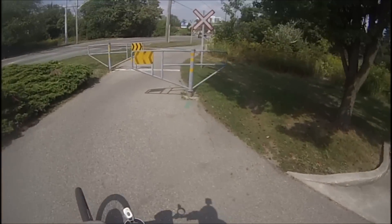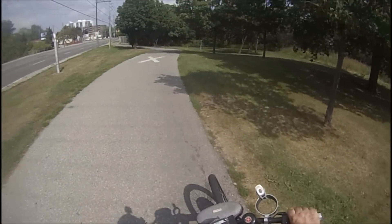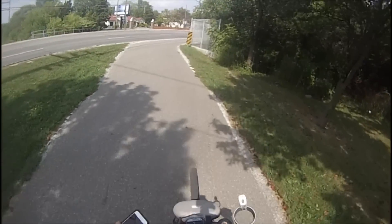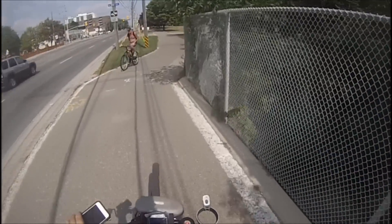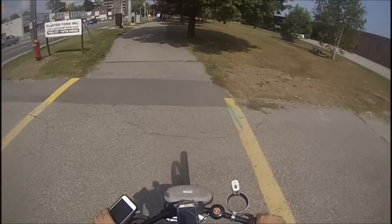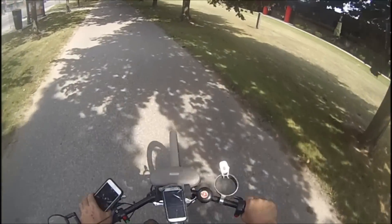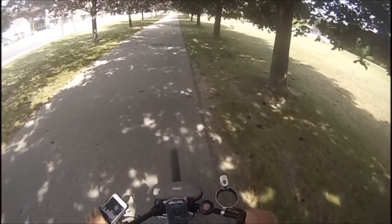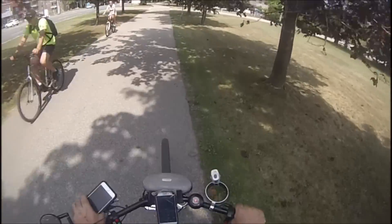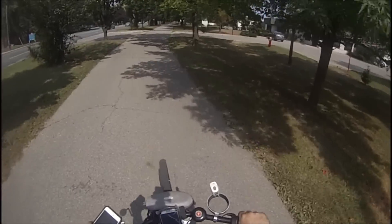We're at 20 kilometers an hour now. This could be different for every bike and every rider — experiment yourself. I seem to be getting 20 kilometers an hour when I have it set at 140, which would be perfect for cycle paths. At this setting of 140 RPM I can go a long way because I'm only burning about two to three amps of power at a time instead of 25. I'm going about 10 kilometers slower than I would otherwise.